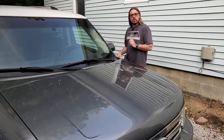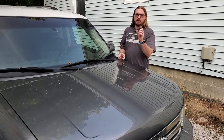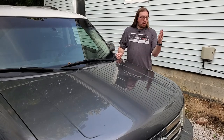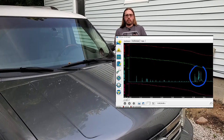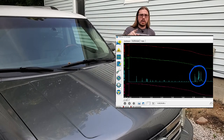I'm out on the road approaching a red light, I start to slow down, and I have a touch of ABS activation — which under 30 miles an hour on dry pavement you're not activating ABS. I look at Forscan and we have this: 39 miles an hour is the right rear tire and the other three are at zero.